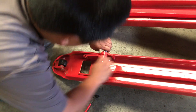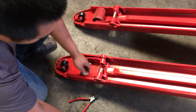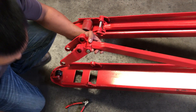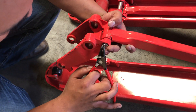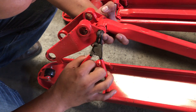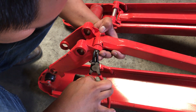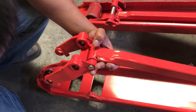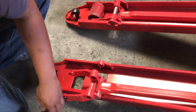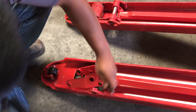Use your punch to get the axle and this whole contraption to come right out. To replace this piece, all you have to do is pull the snap ring out, get a smaller punch, get the snap ring out, pull out that pin — same concept, just knock it out to the other side.